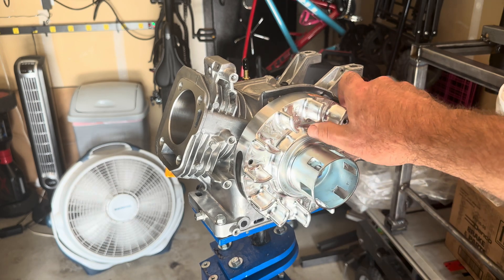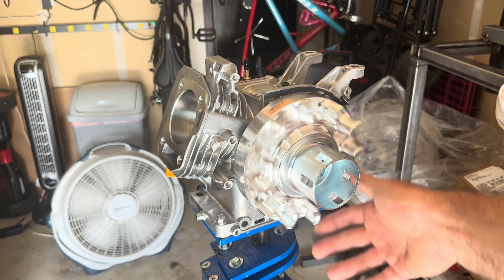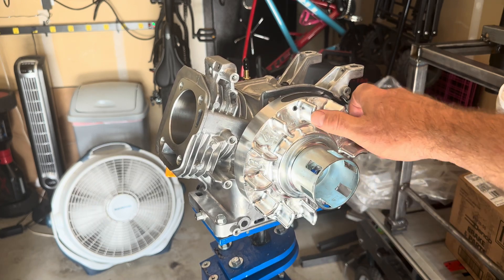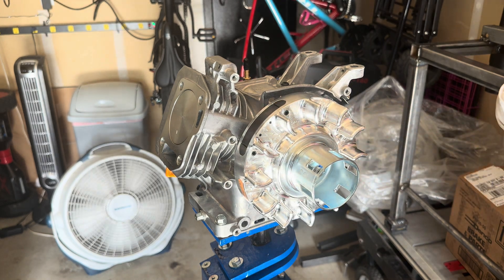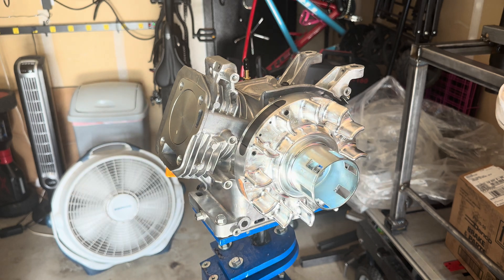Nice smooth spin — we've got new bearings. When you're building an engine, even if you've taken apart a brand new one out of the box, replace the bearings. I put in slightly higher quality bearings anyway. Don't cheap out — spend ten dollars on a set of bearings and five dollars on some new seals. Just ensure you've got a good engine.